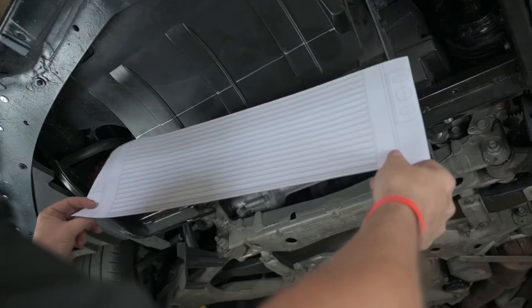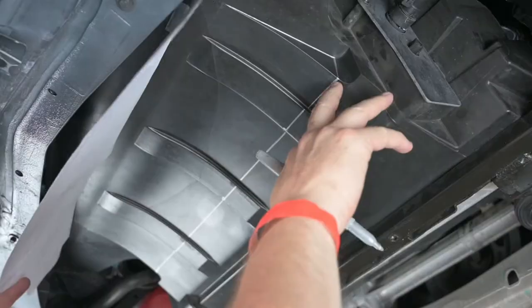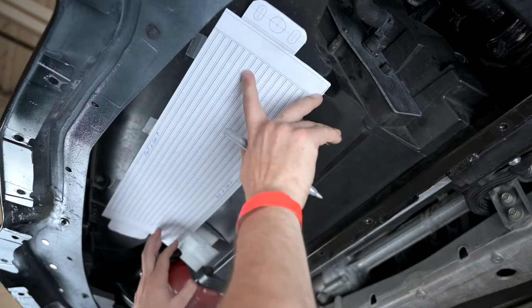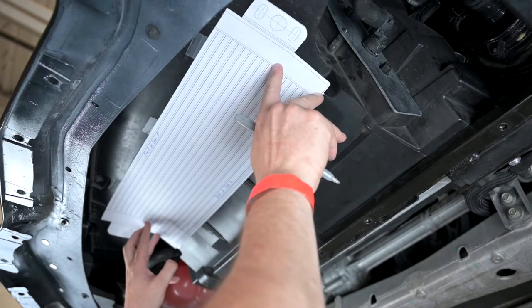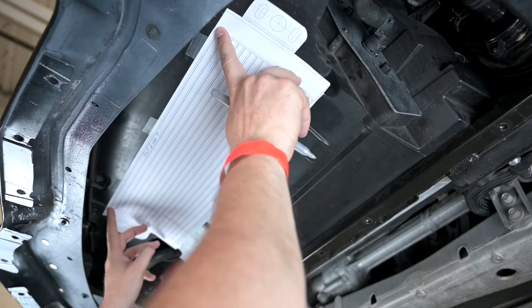Locate the paper template supplied in your kit, and place it along the bottom edge on your drawn reference line. Use Scotch tape to keep the template in place. Center the template by using the inner set of vertical lines on the template and align them with the molded lines in the plastic cover. The vertical lines on the template represent the inside of the tanks on the cooler.